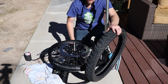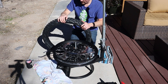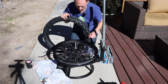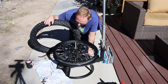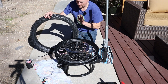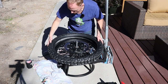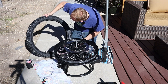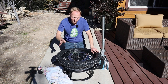This old tire's probably going to go to the garbage dump because nobody likes the Karoo 3s. Now with the brand new tire, a few things to keep in mind. The most important is that most tires are directional, so look for any directional indications and make sure you're going the right direction. On a bike with two disc brakes, both sides of the rim look the same, so you have to really look carefully. I found the arrow on the rim that shows the direction of travel — when the bike's going forward, that should be pointed forward. Find the directional arrow on the sidewall and make sure it's traveling the same direction.